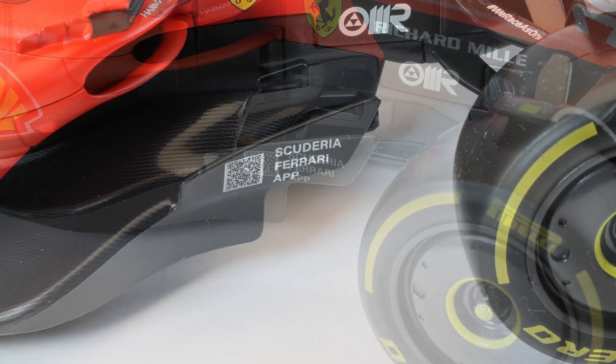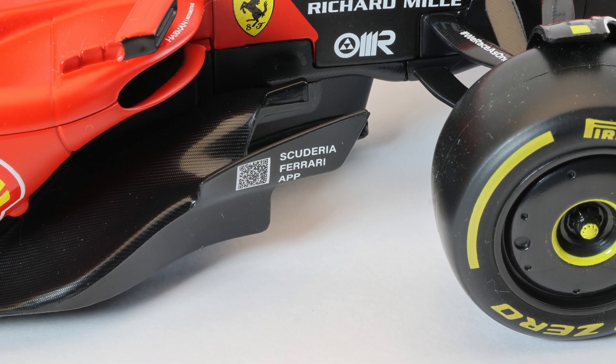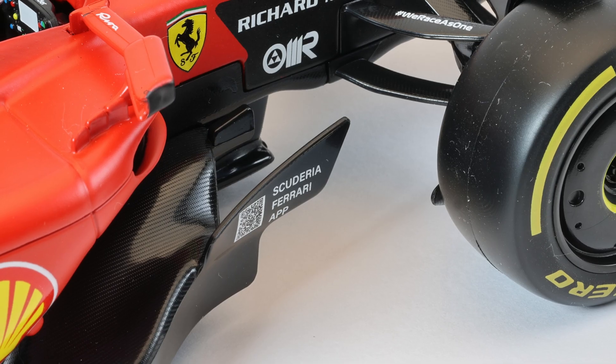The primary purpose is to direct the air made turbulent by the front wing, the suspension supports, and the front wheels, outside the car — conveying the flow's dirty air away from the car body. This is known as the outwash effect, on the back of the car.